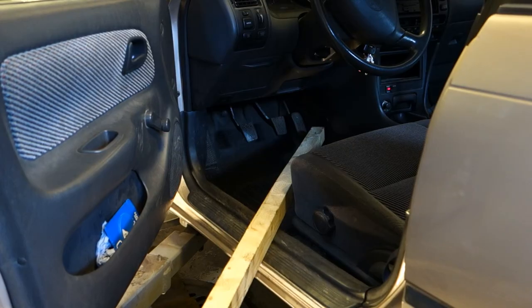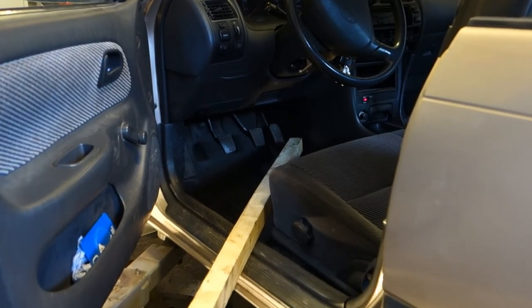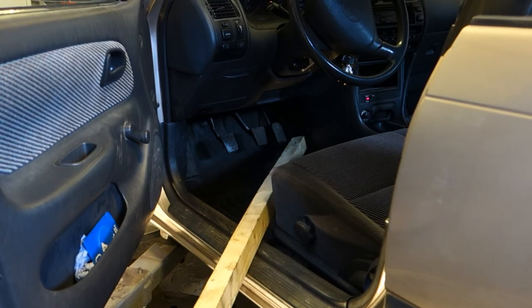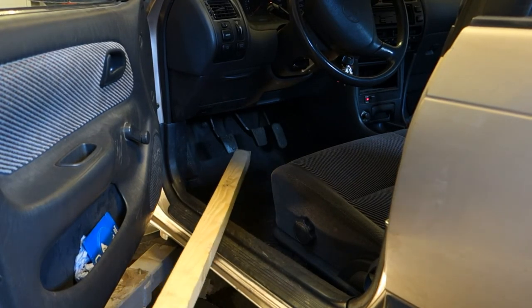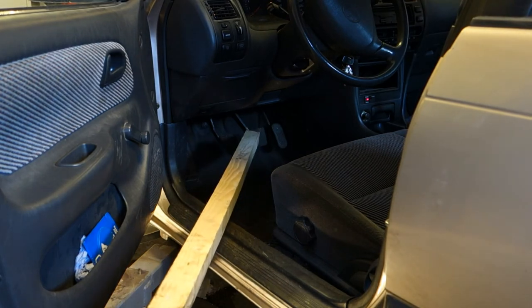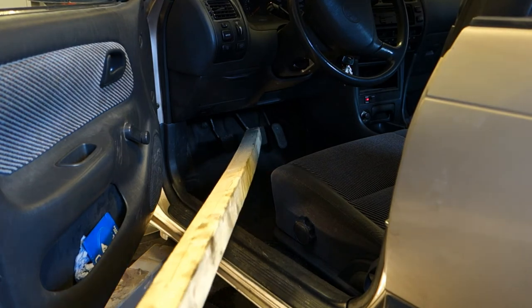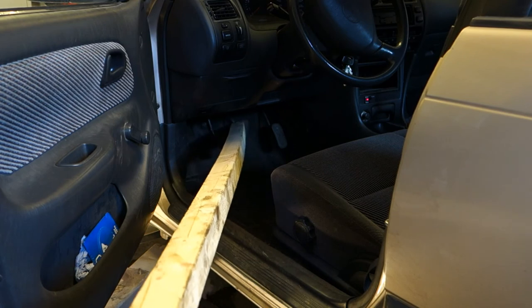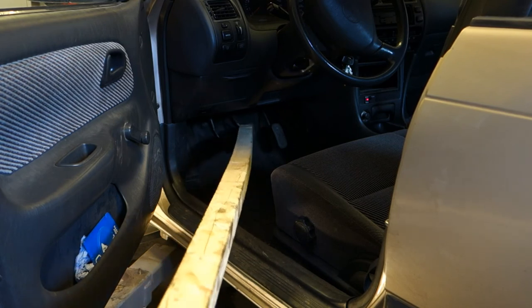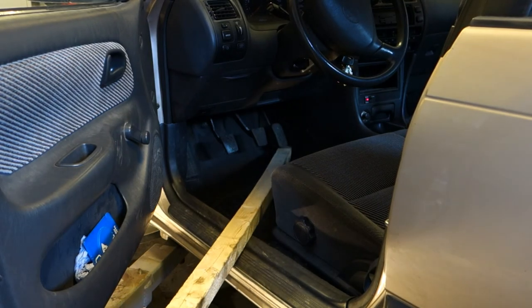Okay, and now we are in this brake pedal area. And then I start to press. I have this long wooden log. I can use that, or we can press it ourselves, or our assistant can press this brake pedal. And then we start to press that brake pedal, and when we press that something like 10 times, we go to look at our brake caliper system next back.